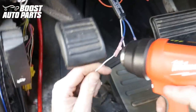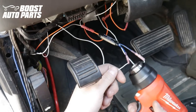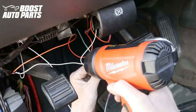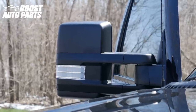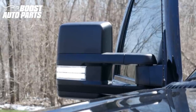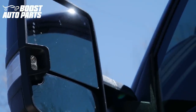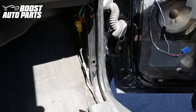We'll just go ahead and use the heat gun and shrink wrap the butt connector. Now we're just going to go ahead and test the running lights — go ahead and turn those on. You can see they're activating on both sides. We'll also test the reverse lights and dome lamp if you did get the dome and reverse. Cannot test the turn signal until the door panels are reassembled, as that will be a plug-and-play feature. We'll go ahead and put this trim piece back on.